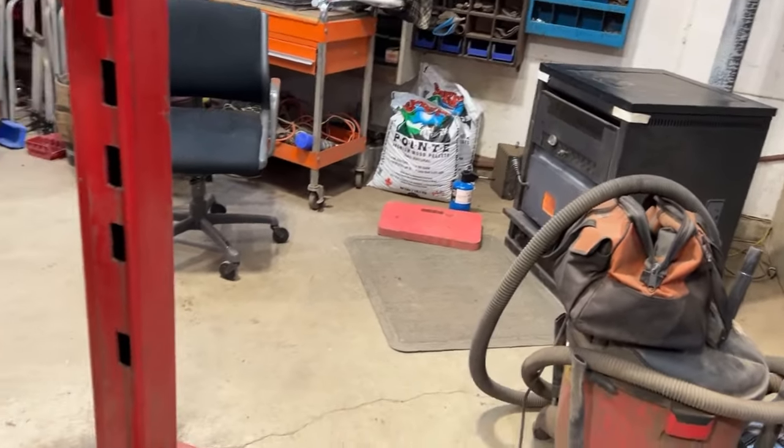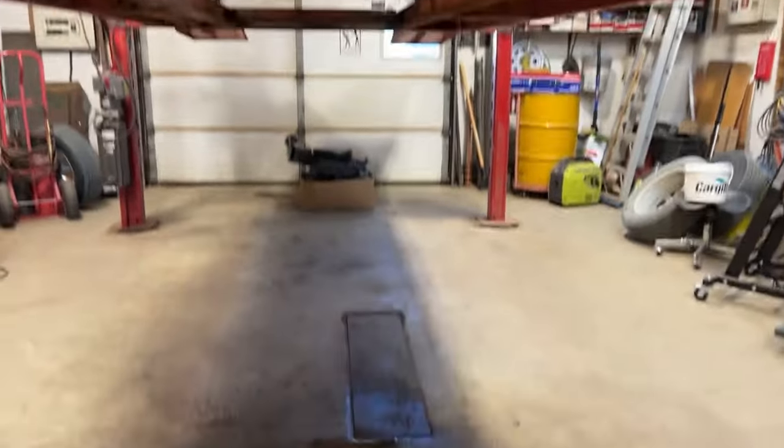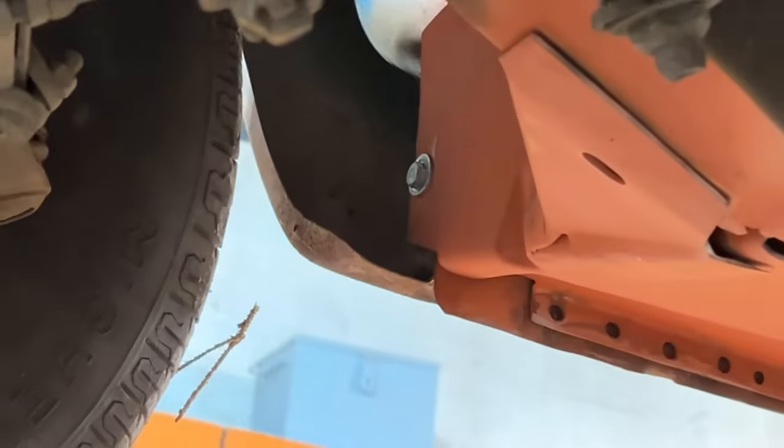Fire's going, heat's on. Did my first little test already. I capped the water pump and the thermostat housing and pulled the plug out of the top of the thermostat housing, then started pouring water in it — and it looks like that's a failure. So this is where we determine whether we proceed with this engine or not. I shone a light up and it's coming out. There is, in fact, a frost plug out — expansion plug, core plug — and this one's behind the motor mount. So regardless, the engine's coming out.